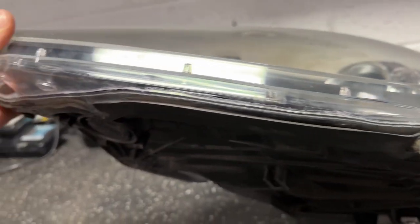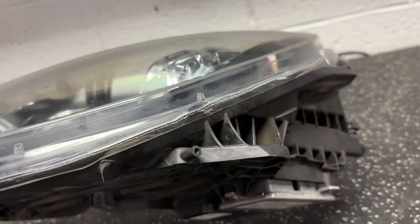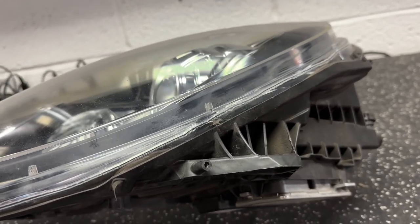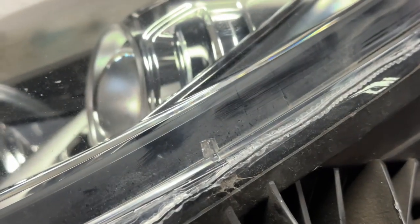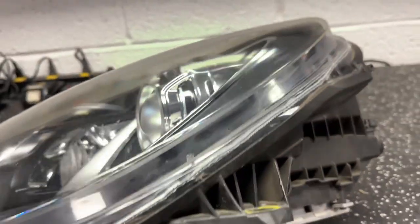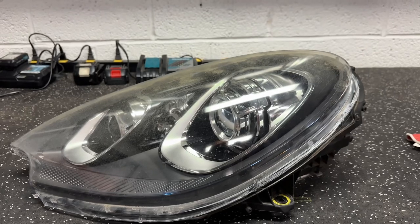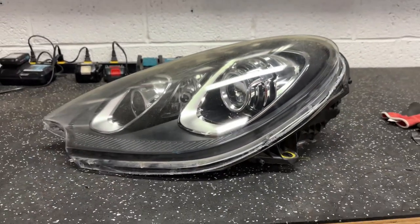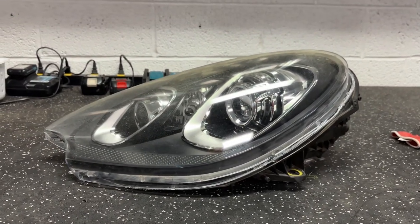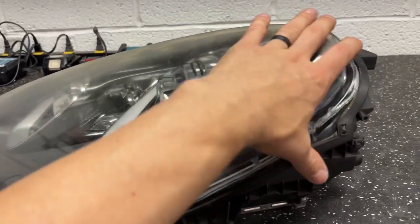I'm working single-handedly this morning so I can't show you how this is done, however you can watch some of our other videos and see how we cut open the light with an ultrasonic cutter. The ultrasonic cutter can be used for a variety of things but it is a very precise cutting tool — it will allow me to remove this lens cleanly and safely without prying the channel, then extract all the pieces out of the back housing. This type of sealant is a one-time use sealant; you can't just reheat it and have it become soft and pliable again.